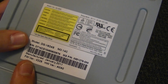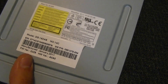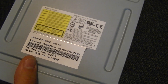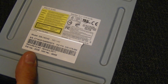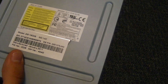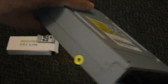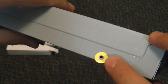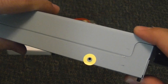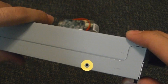A good way of identifying this without opening up your Xbox 360 is to look at the back of the console. If it has been manufactured any time before August 2011, then you can flash it if it has a LiteOn drive. Another way of looking at it — when you're looking at the top of the system, you're going to see a circular sticker. This is the emergency eject. If it is yellow, it is a LiteOn drive, and if it has been manufactured before August 2011, it will be a 16D4S.